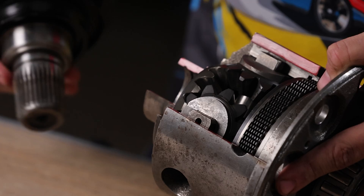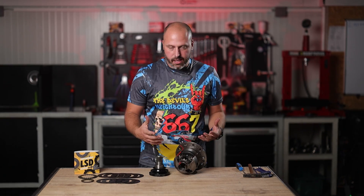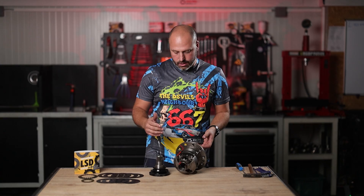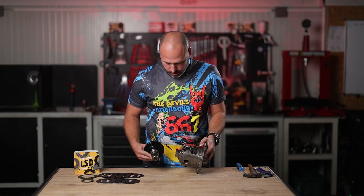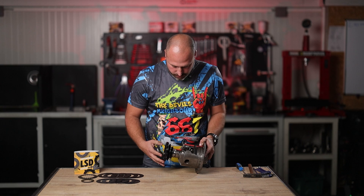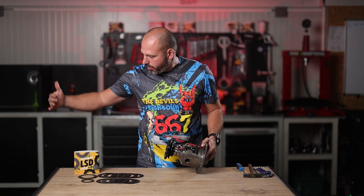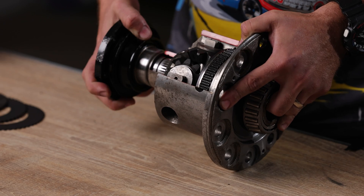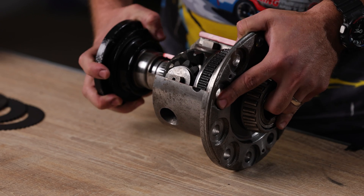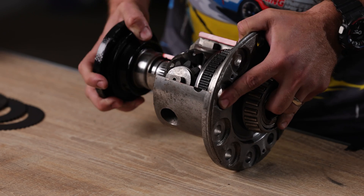What is happening when you put the flange inside? Imagine this is the differential inside the housing at the rear end of your car — it stands like this, so you have the right output flange here, then the axle, wheel bearing, wheel and so on. You can spot it right here — when you leave the car on the jack you can feel the free play on the right side output flange.